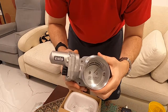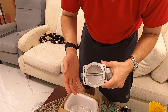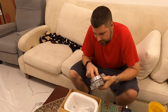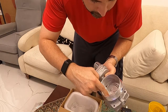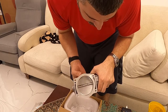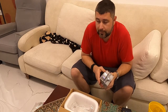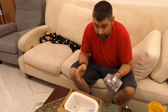You can see where they've hogged it out a bit. What they've done is a little bit different — a normal ported throttle body they just make it bigger, smoother, flow a little bit more air. But these guys have actually taken design even into the throttle blade itself, where they've tapered it off, ported it, and polished it. The LS2 throttle body opens this way; the gold blade LS3 throttle body opens the opposite direction, that's why you can't use them on an LS2. You can however update the tune and run a harness to use an LS3 throttle body on an LS2, allegedly.